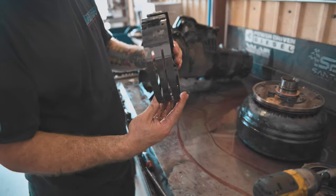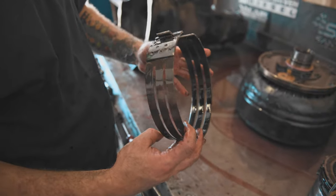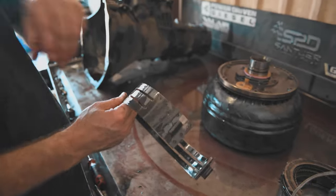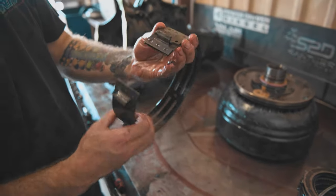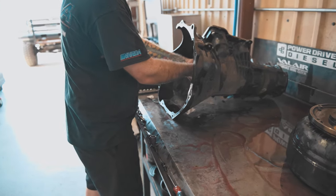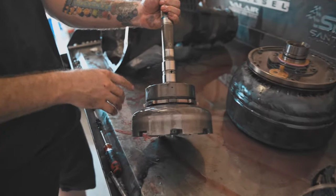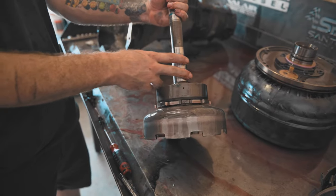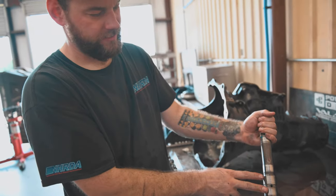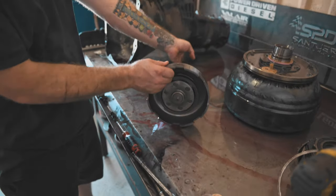Here's your band. Typical wear. Typical style stock-ish band. This one might be upgraded - it's supposed to have more rivets in it if it's upgraded. I have the bands that I trust and I run. That's a good sign that your gear cluster here slid completely out with no problems. If you have a cooler flow restriction, they generally will gall up and basically weld to the overdrive retainer. So that's good that it just slid right out - that's a very good sign.